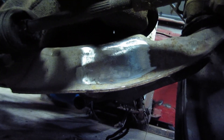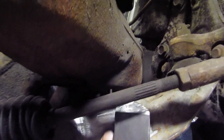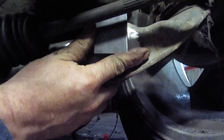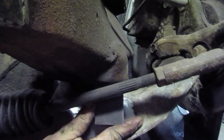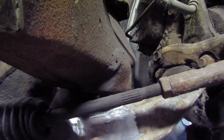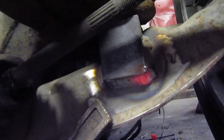I've cocked the wheel over all the way to make sure there's plenty of clearance in there for that stop and to get a full lock on the wheel. The power rack is not having a problem right there, so we'll be able to weld that stop in just like that and grab the full face of this - get a big chunk of it. I'm gonna go ahead and weld the stop in now.